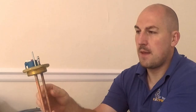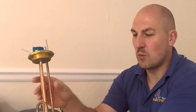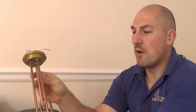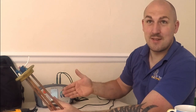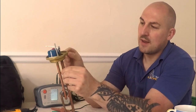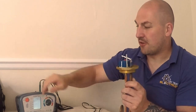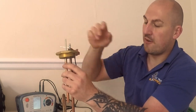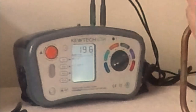I find these things quite interesting — they're quite old school. It's still one of the things that doesn't have a lot of moving parts or circuit boards. Because of this, you can calculate whether anything's wrong with it. Remember: it's called a resistance heater because it works on resistance, so you can use a resistance meter to see if it's working correctly. This tube here — it looks a bit like a trombone — has a live terminal and a neutral terminal. You can get your resistance meter, put it on continuity, remove the thermostat, and stick one probe on the live terminal and one on the neutral terminal.